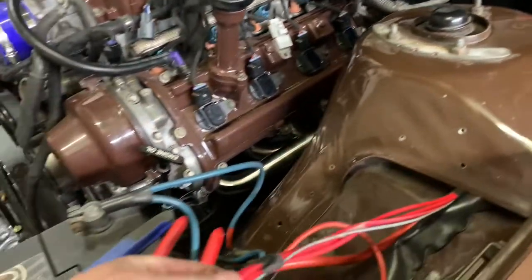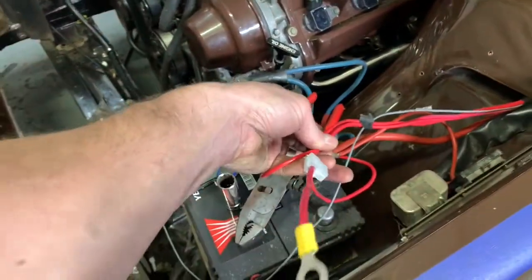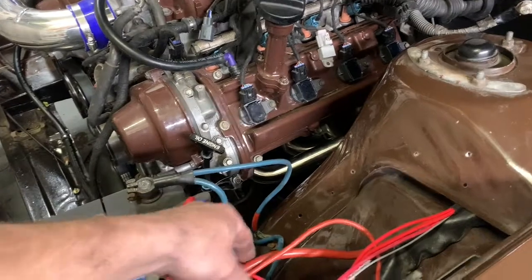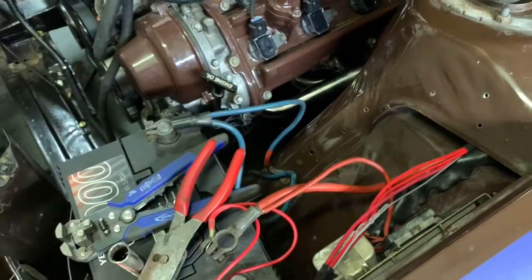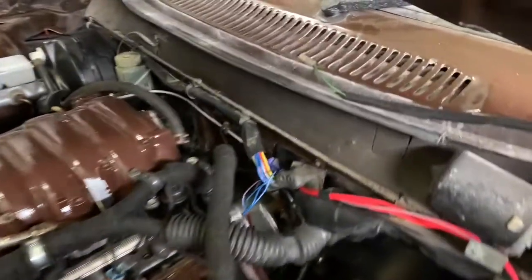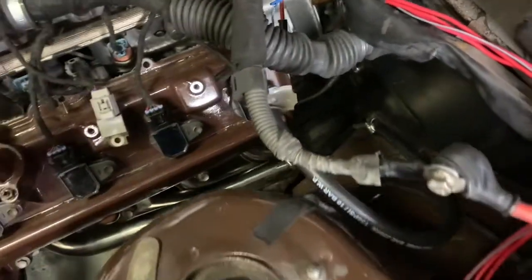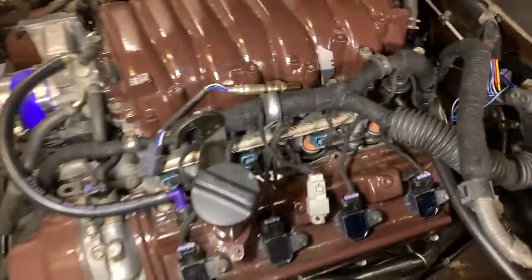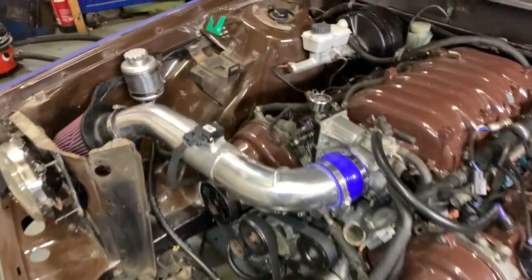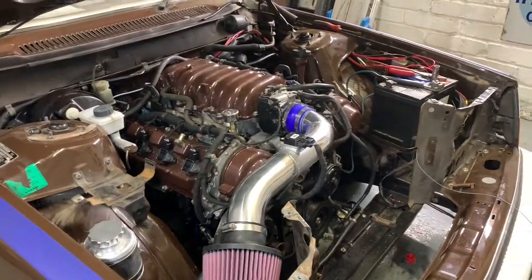I've got a couple of lives for the new fuse box, one for the stereo for later, and one for the oil pressure gauge. I'll temporarily put them on the positive terminal but I'll have a second unit there. Fuel lines are connected. I don't have the O2 sensors in because I've only got exhaust on one side, so tonight's fire-up is just to pressurize the fuel system and do a little run — no coolant, literally just to make sure it runs.